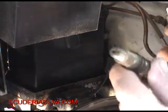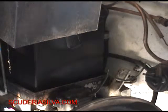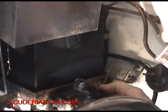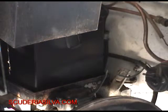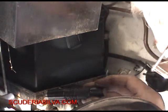Now we'll notice that this one has a flat end on it. The male side came out of the body from the front, and the rear piece goes into the brake lines and it has a flat. Normally if you had a flat, you would have a copper washer on here, and I don't see one on here. This does not have any copper on it whatsoever — that is very interesting. There's no reason why we shouldn't have been losing brake fluid out of here, except by luck.